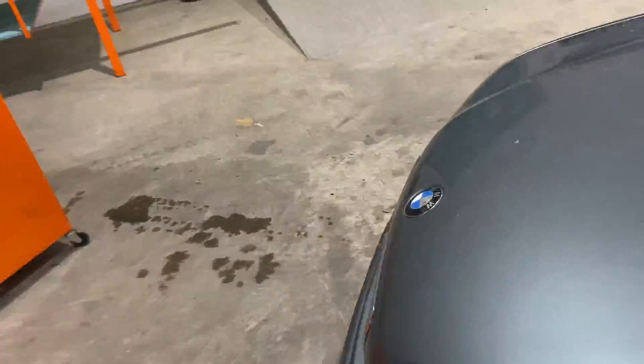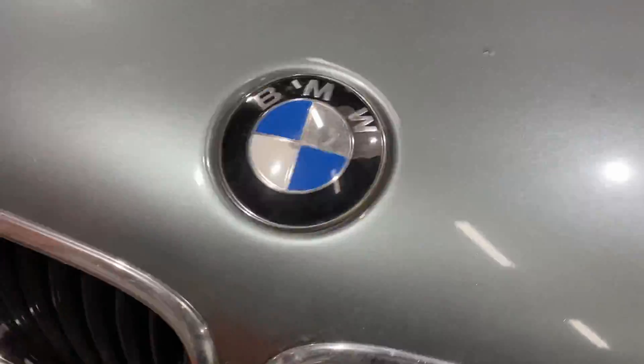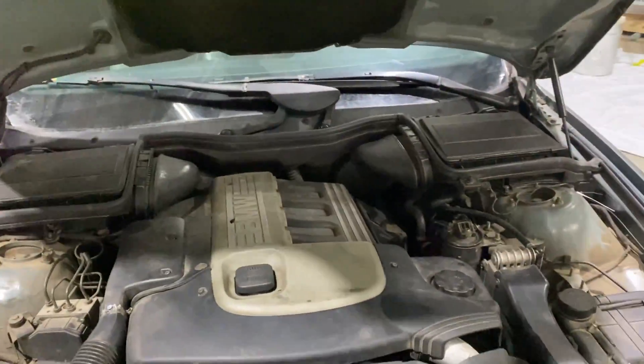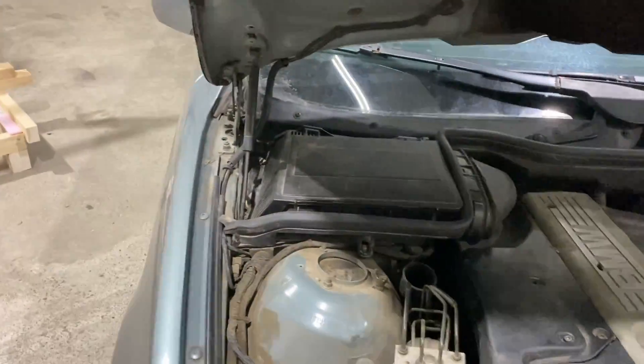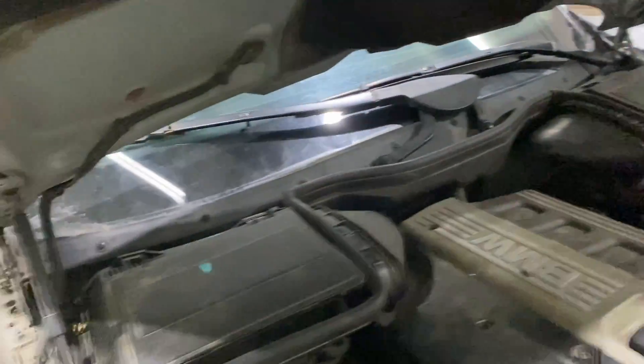First step, what you're going to do is just go into the footwell and open up the hood. There's a latch right here — we're going to flip this up and pull up the hood. Now excuse the uncleanliness of this engine, but here's one and right there is the other cabin air filter.